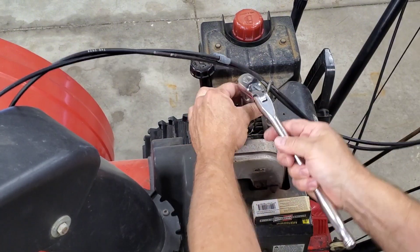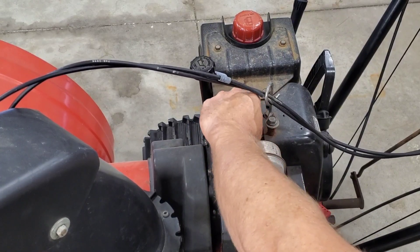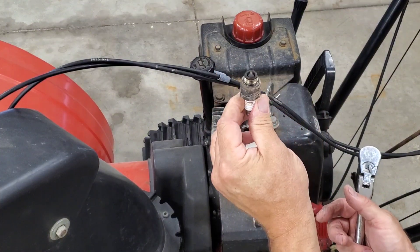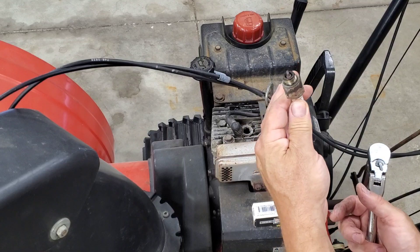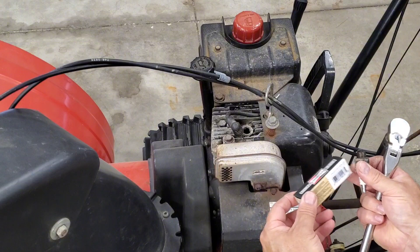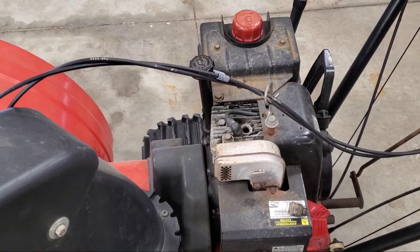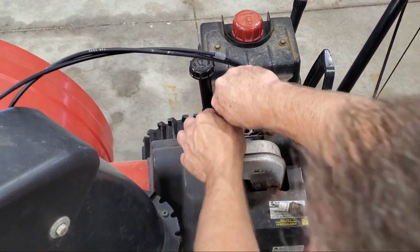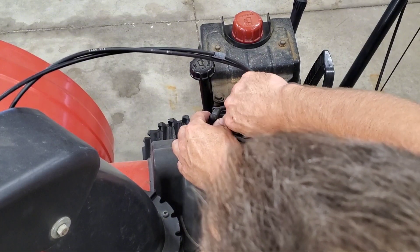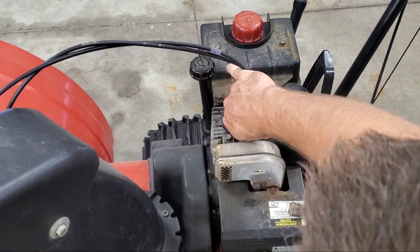The spark plug is not even very tight on it. It looks old — you can see it's pretty old. It's not in rough shape but it's not good. It doesn't have wet oil; of course it hasn't run for a while so it could have dried up. So we'll put a new one on. I ordered a Champion, same number — it's the RJ19LM. I added a little bit of anti-seize to the threads. I checked the gap: it's 30 thousandths, and the spec says 29 to 33, so I set it at 30 thousandths. That was based on the spark plug number for this make and model.